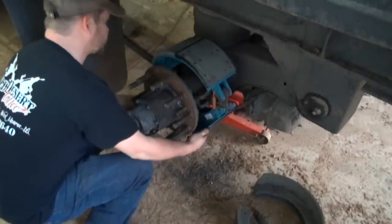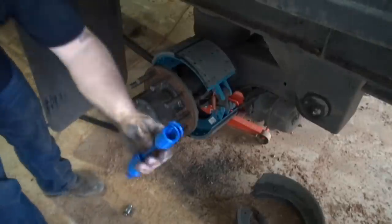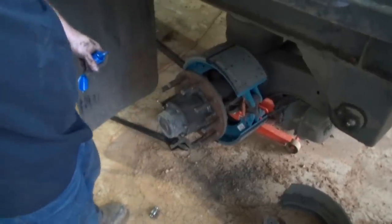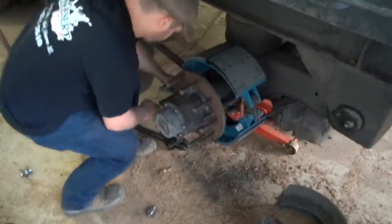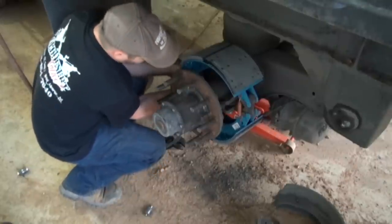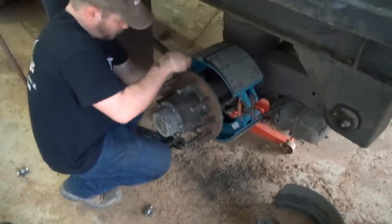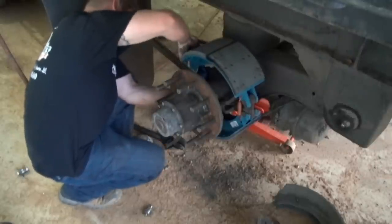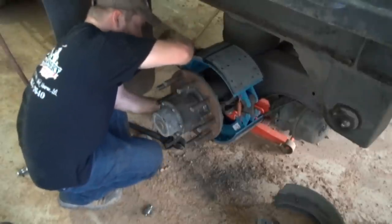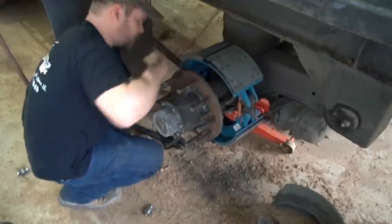That stretches your springs. You take your one other spring, this big blue one in this instance here, it goes on the other side. That's where we pull the other one out from. Should be able to get it to hang in there like that and bring that shoe up and hook it in your top one there. May work better if you hook it on the top one first. See a little bit better what you're doing.